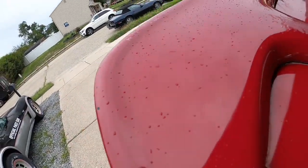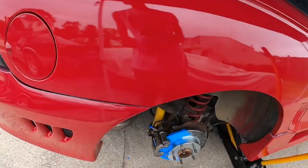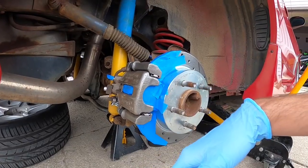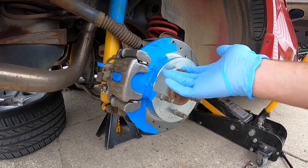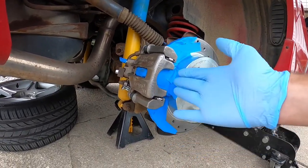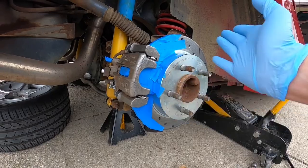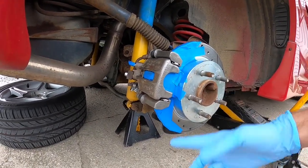As you can see, it's starting to rain — I'm not going to let that stop me with one caliper left. I took my red Scotch-Brite pad to it. The caliper cleaner is basically a wax and grease remover — a degreaser — that's what they tell you to put on it. They don't even say to use the Scotch-Brite pad; I'm doing that because they're rusted. You should sand the rust so it doesn't come back through, and sanding also gives the paint more bite.